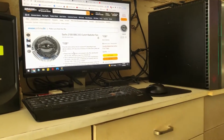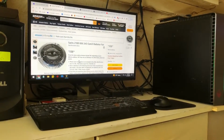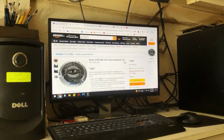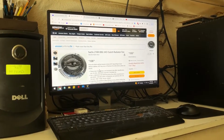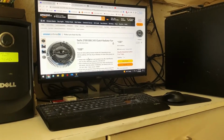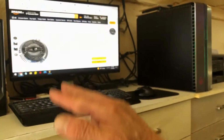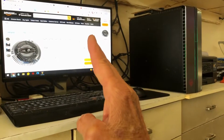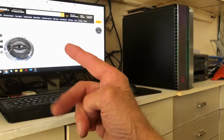But see, I guess most of these cars just don't have this overheating problem, but a lot of them do. And if you're searching and you're going, why is my 300E, why is my M104 engine, why is my M119 engine, why is it when I'm idling during the summer with the air conditioning on, the temperature goes into the red, and I don't like having that temperature get to that red. The manual says it's okay, but you know what? I've replaced a head gasket in that car twice because of this kind of crap.